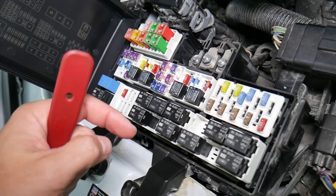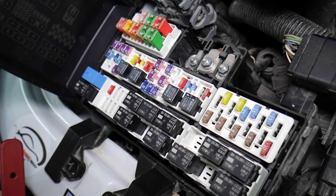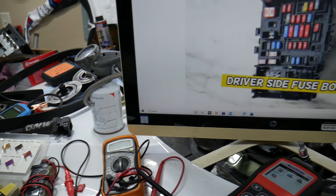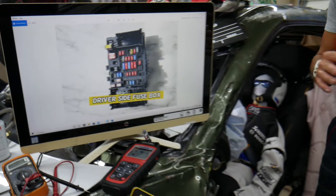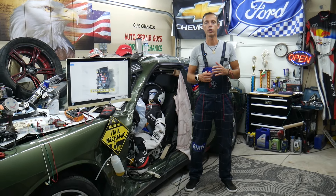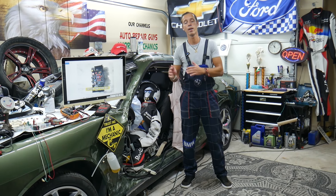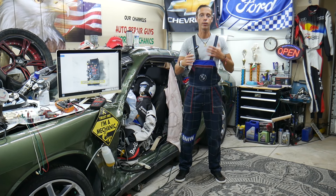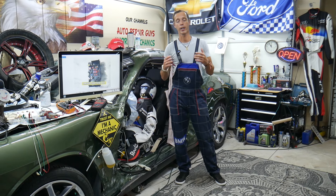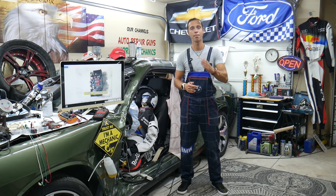We'll put a link to a special video that will teach you how to test fuses and how to check relays very easily. So check it out — it will be in the description of the video below. For the TPMS system, there is very limited information about the TPMS fuses. Usually those are not separate fuses that you can just go ahead and pull. Why? Because it's a safety feature, just kind of like an airbag — so you must have those. A few different systems will work together and there will be a few different fuses. Some of the fuses that we'll recommend to check are the BCM fuses.